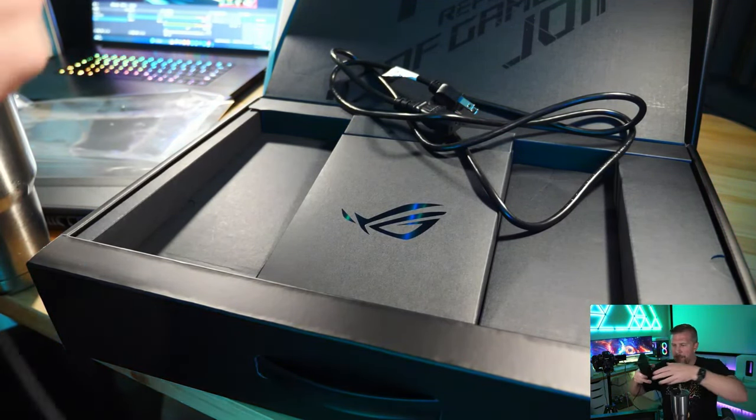16,761. So basically the exact same test again. Let's get a 10-minute test going. So our CPU package power is pulling 110 watts. So far averaging 100 watts. Our temperatures are getting warm though. We're doing 95, 96 degrees, 93 degrees on average. The fans are on maximum fan right now, and they are about as loud as your typical gaming laptop fans.